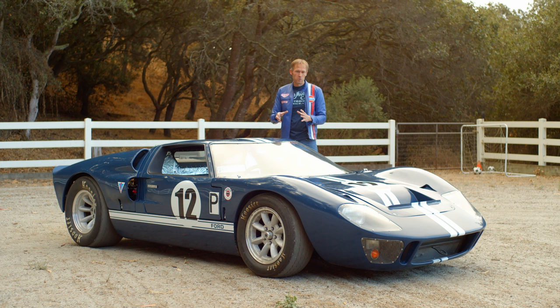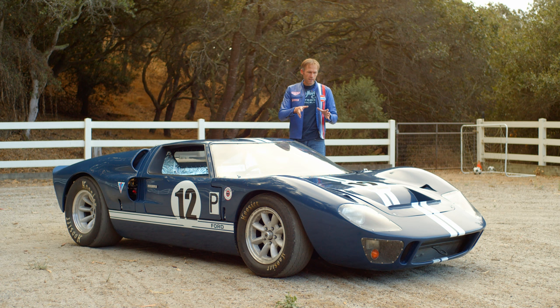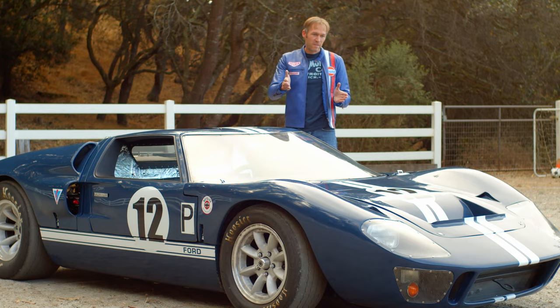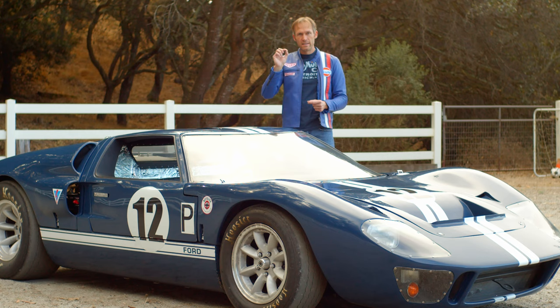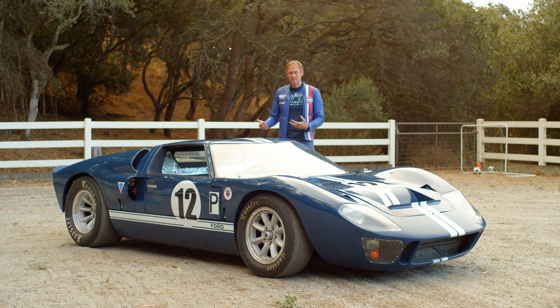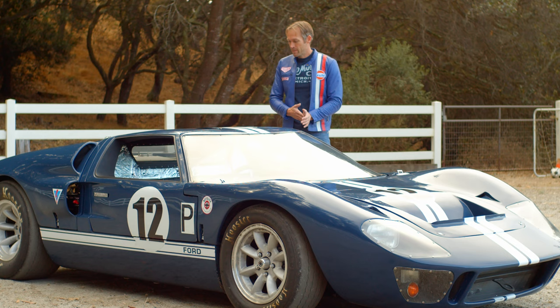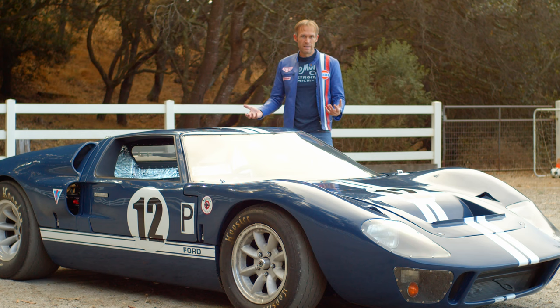I also found one side had about 0.3 of a degree more caster than the other side. I had to figure out a new way to measure caster because if you measure it without changing anything three times, you get slightly different results each time, which really drives me crazy. I think I've got a new system that gives repeatable results. The other thing that made the most sense was a small tear in the CV boot on the rear — it was spraying a fine bit of grease. You'd think that got on the brake rotor and caused uneven braking, but I couldn't find any evidence the grease was actually reaching the rotor.